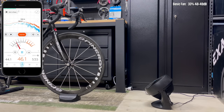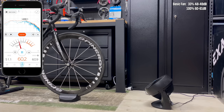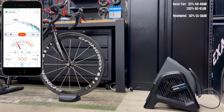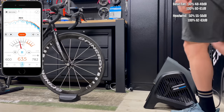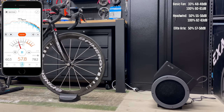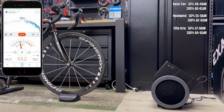On to some sound checks and wind profile checks. Starting with the very small basic fan at 33% — it only has three settings — and then at 100% it measures 60 to 61 decibels. There are a lot of variables that go into the noise made by devices; this is just one environment. The Headwind at 50% is recorded with an iPhone up on the bench, and at 100% it measures 62 to 63 decibels. The Aria at 50% measures 57 to 58 decibels, and up at 100% measures 64 to 65 decibels.